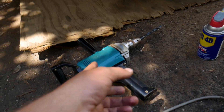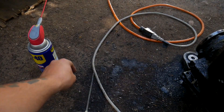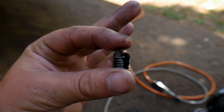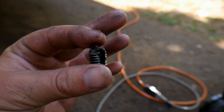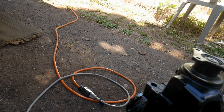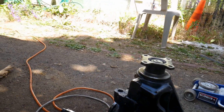This thing's badass - it just completely shot that bolt out right here. That's why I couldn't grab it with the screw extractor - we had drilled a little on the edge. That worked awesome, just shot it right out and made a big enough hole. Still not quite half inch but I think we'll figure it out. I gotta drill through the bushing too and figure out a bolt to get through there.